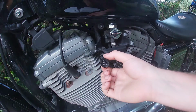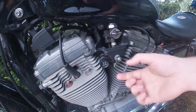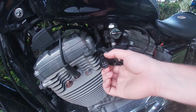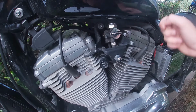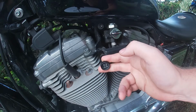The reason for that is you have this adjuster here, which is used to make sure you have tension on the lever of the cable so it doesn't spring back in. Now over time, this will commonly loosen itself and then it will start to spring back in. So what you are able to do is just simply tighten this up, which you may not be able to do by hand, in which case I will commonly use a pair of channel locks. And then you just adjust it until you get just enough tension on it and then it will stay out.